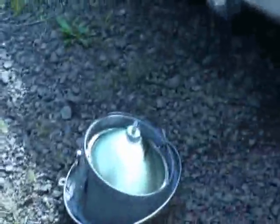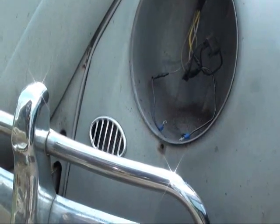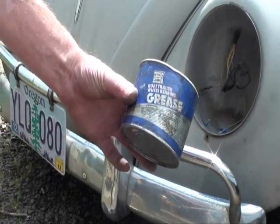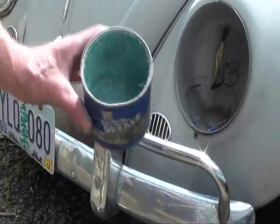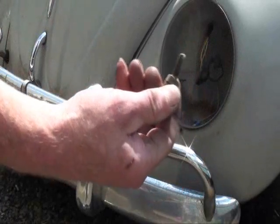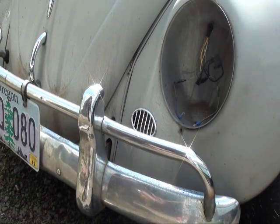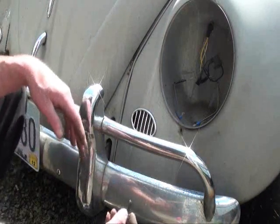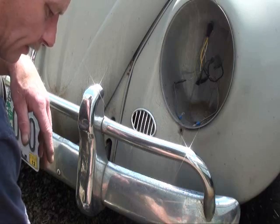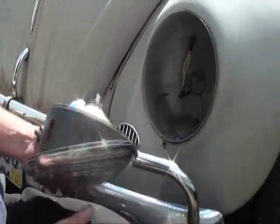Here's a little trick. Something I do — I keep an extra can of boat trailer wheel bearing grease around. It's waterproof grease. I generally just put a tiny daub on the end of the threads before I crank them in on just about every bolt that I take out of these cars, to keep them from seizing up. Especially in places like this where it gets a lot of water and road spray and everything else. That way you're not looking to weld in a new nut on the back side of your fender later.